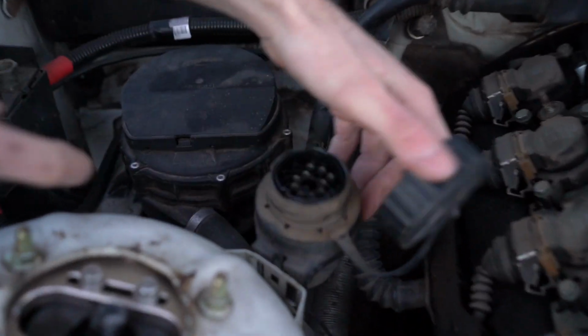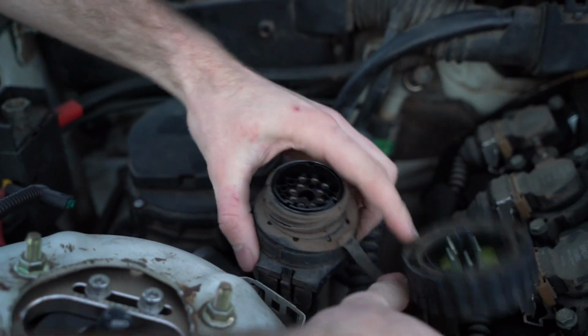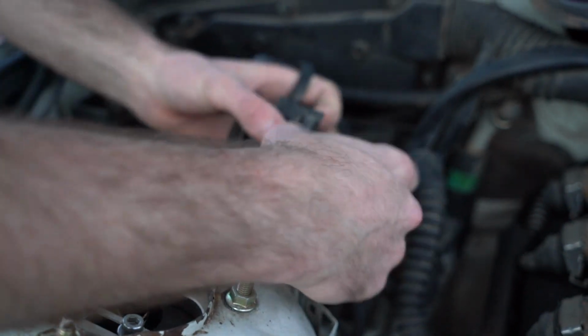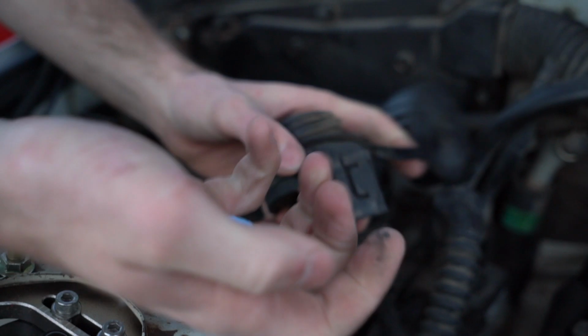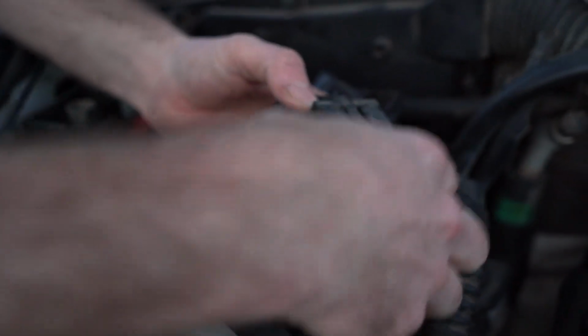It's this little guy right here. I've already had it taken apart, so you just push this little pin, it pops right up. Pin number 14 and 18, they're labeled really, really closely down there, but I took the boot off and I think the instructions said it's a big red and green wire, but mainly go by the pins. So we're gonna go ahead and splice those together with this little guy and reassemble it all. We should be pretty good.